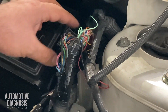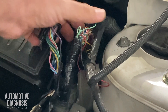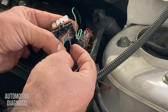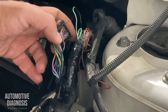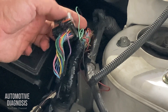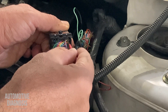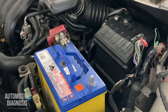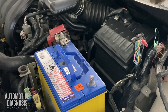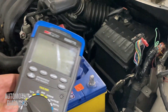For checking the control line and the ECM — the ECM is located here. As you can see, someone did quite a big job on the wiring here. This wire is the control line for injector number four, and as you can see some repair has been done on it. I'm not sure if it was done correctly because obviously my injector isn't working. I'll use a back-probe here on that purple wire — the injector number four control line on the ECM connector side — and use the multimeter to check the continuity.